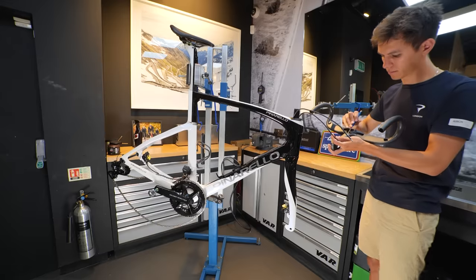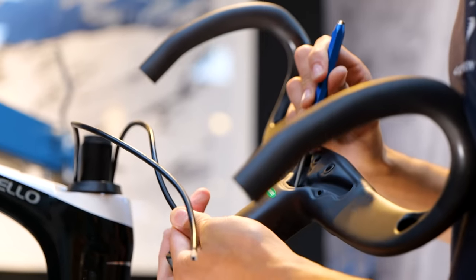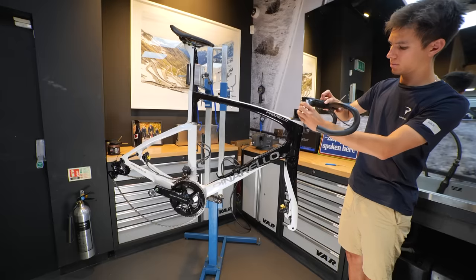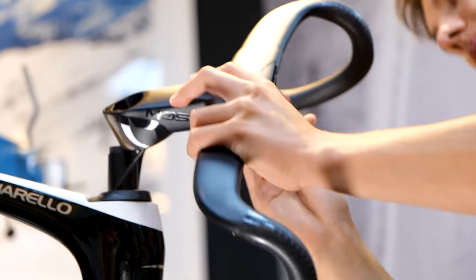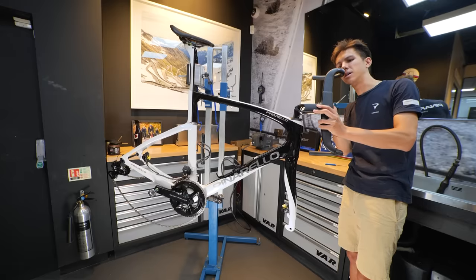When it comes to installing the new handlebars, Tristan was kind enough to put the white decals on the side of the stem to match the color of my bike and then carefully remove the small cover which sits underneath where the head unit mount goes. This gains him access to reroute the brake hoses through the stem and out the front of the handlebar at the same time as placing the handlebar onto the steerer tube of the fork. To get the hoses through, a small pick or screwdriver is going to come in handy here. An important point to remember is that you need to route the hoses the correct way round for how you have your brakes set up, which in my case is left rear, right front.